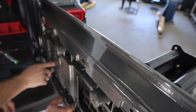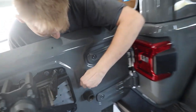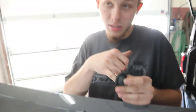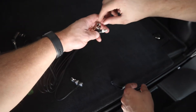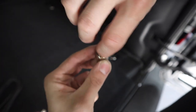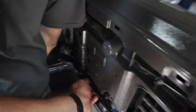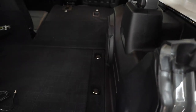What we're going to do is, when we run that antenna wire through here, we're going to open this little thing right here and run it. But then we've got to take all that apart in there. I've seen guys run it through here too. We'll just drill a hole in that — put a little T-slit in it and then put some RTV in there. This connector does come off; you need to run it through. You can use your fingernails — see the two little notches? You grab that and twist the actual inside piece instead of just twisting the collet. It'll make it easier when fishing it through the T-slot in your tailgate. Then we'll open up this loom right here, feed the wire through, take all this out, and run it all the way up to the front of the Jeep.